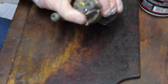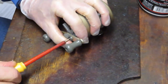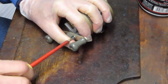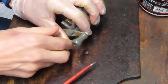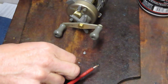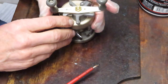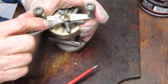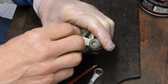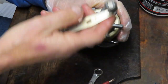We're going to start by removing the external pieces. First, I'd like to stop and thank our first responders and essential personnel — all the people working to help keep us safe during the pandemic. Looks like we have a problem here with the cap; it was either glued or just broken in place over time. We'll have to find a replacement. Next, there's a 10mm nut that holds the handle onto the gear shaft — that gets removed, and then we can remove the handle.